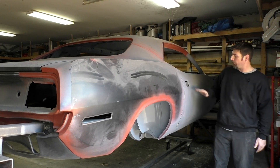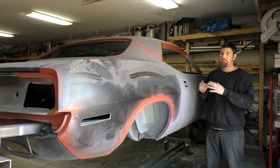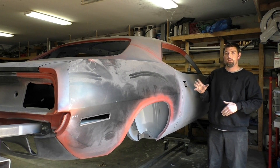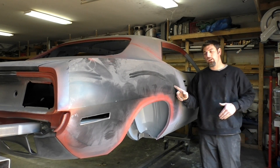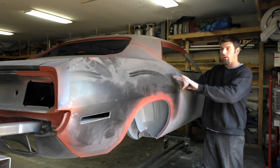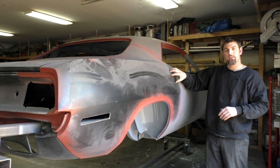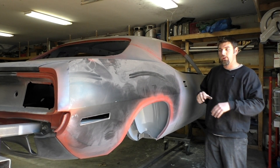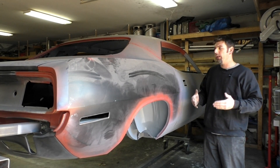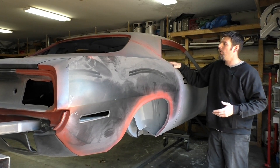As you can see it's been sitting for a while. It's got lots of dirt on it. When we go to do the lead, everything's got to be bare metal and really clean. We're going to go ahead through first and strip out all the e-coat. You see we got etching primer on this car to protect the bare metal when all these new panels were done. We want to put a good epoxy after the lead work and seal this car up before the body work stage. We're first going to go ahead and take our Eastwood stripping disc and strip this car down.